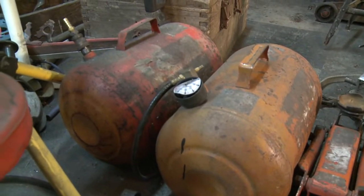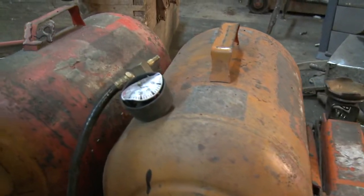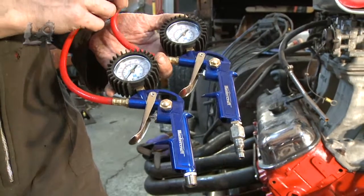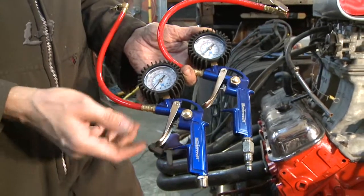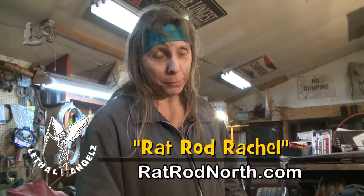I have some air tanks — you can readily buy them anywhere, trade them at garage sales. They're really reliable; they're actually used to bring air to a flat tire and sometimes stay in shops full of air for long periods of time without losing air. I also opted to use two trigger guns — their main purpose is to put air pressure in tires, but they have a unique feature: you can pump up a tire and you can actually remove the air with them. The same system with all the solenoids and bells and whistles costs a lot more; these were roughly $16 at Canadian Tire. I run them manually. Being on a budget on a rat rod, they work. All I have to do is plumb them in and put my spare reserve tanks on there, make sure I have air in them, and I know my bags are going to hold. Airbag problem solved — plus I got the car slammed, which is really cool.